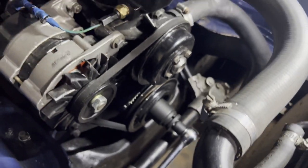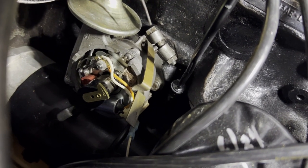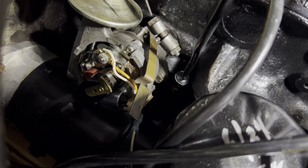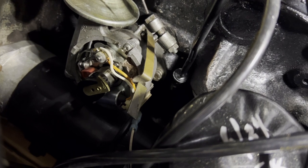I just brought it up and around. I popped the distributor cap off to see where the rotor is. You can see it's about the 1 o'clock position, which is top dead center on the MGB. So we'll start there.